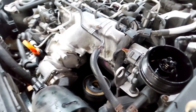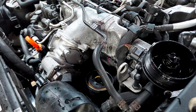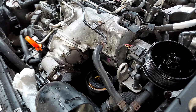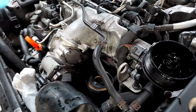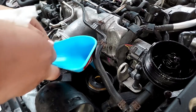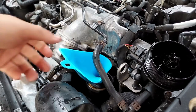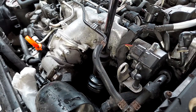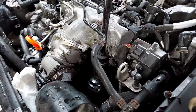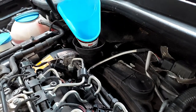It's a good idea to put a little oil in the filter housing. Grab the old filter - make sure it's nice and clean. Only a little bit of crud - those kidney stones are getting kind of large, but she'll be all right. New filter goes in. Make sure the 33 millimeter goes back on there. There's probably some sort of torque spec for this, but good enough. The filter is installed - you're ready for some oil.